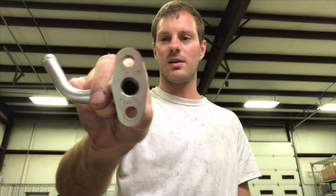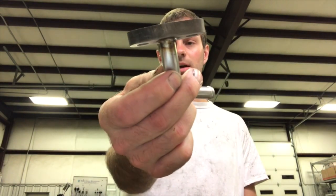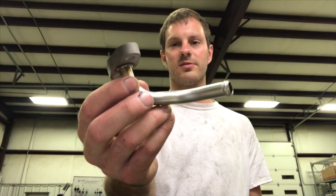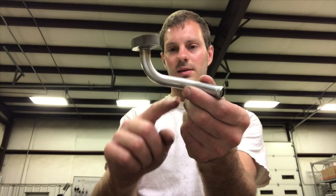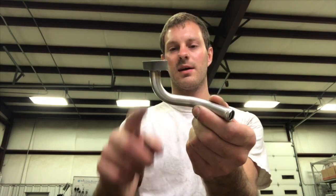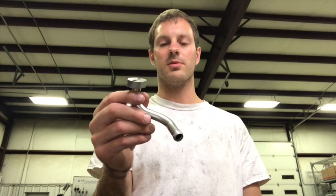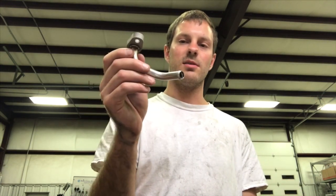Here's a look at the oil drain before we ported it out — it's tiny in diameter on the alpha drain, which I think is an issue. This could still have the same problem after installation. The drain exits at 90 degrees; being so small in diameter, he may not get away with it as easily as with a bigger drain. If you have this setup on your car, if you're leaking oil out of the turbos, this is always the first thing to check.